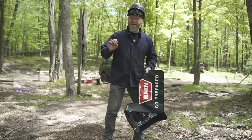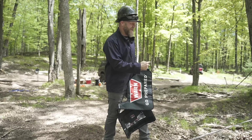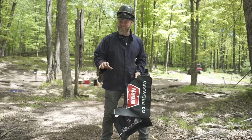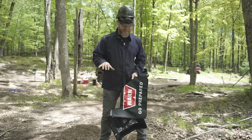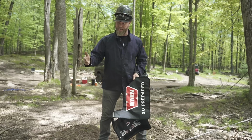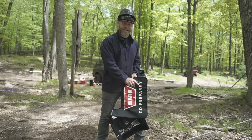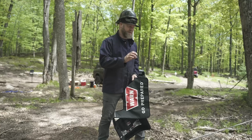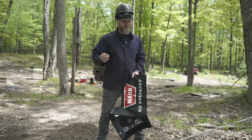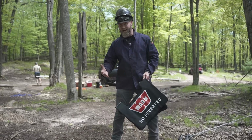All right, well, I was definitely not expecting that hook to go flying as hard and as fast as it did after that ratchet strap broke. That was impressive. Actually, it was a little bit scary because, I mean, all the winching I've done, I've never actually had something break, and to watch this weak point break and that hook go flying like it did, it was kind of scary to know that if somebody was standing in that danger zone, they're gonna get seriously hurt, if not worse. So that first run was without a weighted blanket.